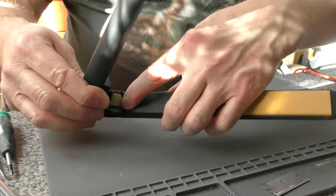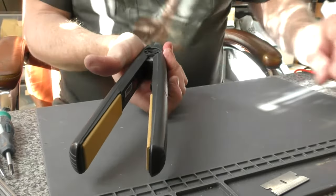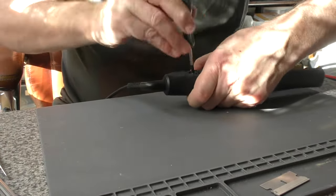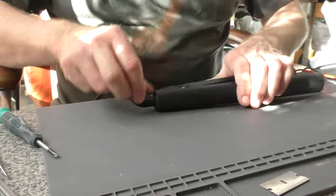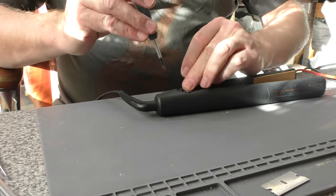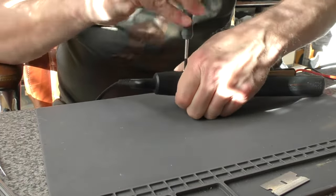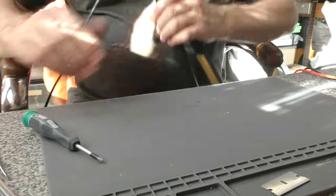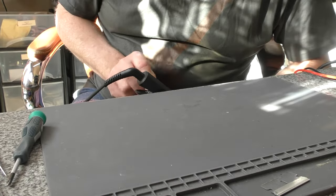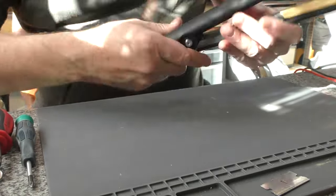With the spring clip down, we lower the other arm into place and then squeeze them together — they are under tension. Drop in the hinge pin; if it doesn't go all the way through, you can put a screwdriver in this side and just wiggle it around so everything lines up. We do not over-tighten this screw and pin, because they can be very tight in the future, especially if they get slightly corroded. So we'll just gently nip this up — it doesn't need to be over tight. If they get corroded it can be a nightmare to undo, especially for people at home. We have an impact driver here if required.